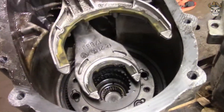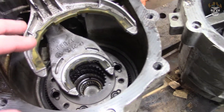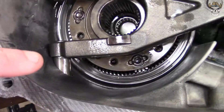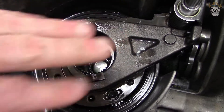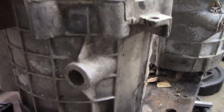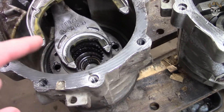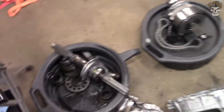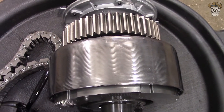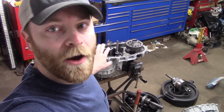I'm not going to go over all of them, but take a look - this is the manual shift and it has aluminum arms. This is not their orientation, I just quickly threw them in for a representation. But come over here - this one has steel arms on it. There's one right there and then there's one here, and it uses little rocker bushings right here to shift up and down, pulling the fork up and down. Those are those pins right there. Now the case over here has a spot for them but they're not actually drilled or tapped, so you couldn't even put this stuff in here if you wanted to. There's your 4-low for the 261 and that's your 4-low for the 246 - quite a few differences.